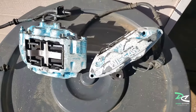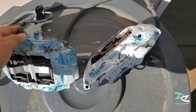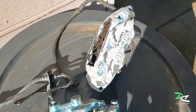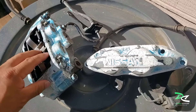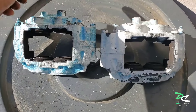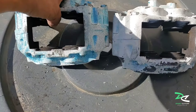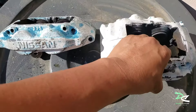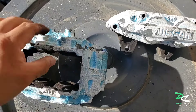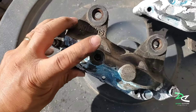Then I'll apply fresh paint and a clear coat. I also need to remove all these brake lines and brackets. So yeah, let's get started. I'll remove all the brake lines, the brackets, and also the brake pads. Right now I'm going to start cleaning and block this hole right here — that's where the brake line is, so I'm gonna block that and then start cleaning.